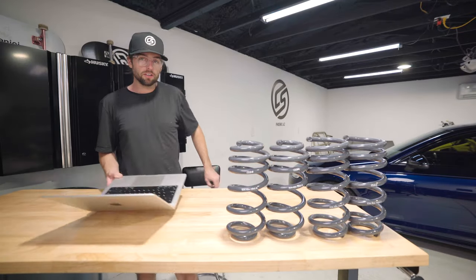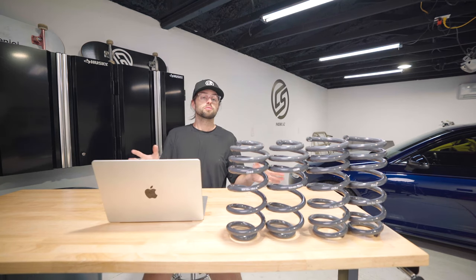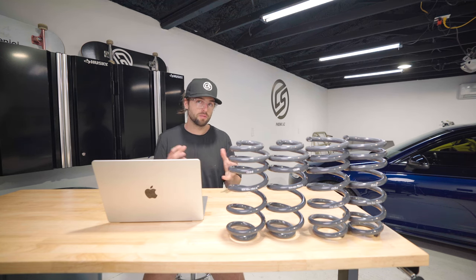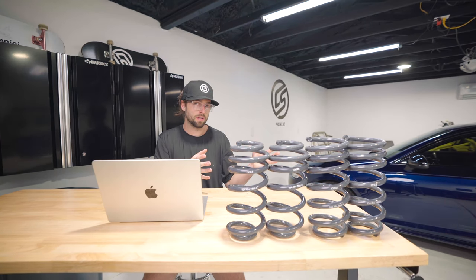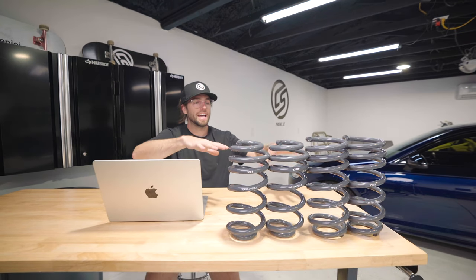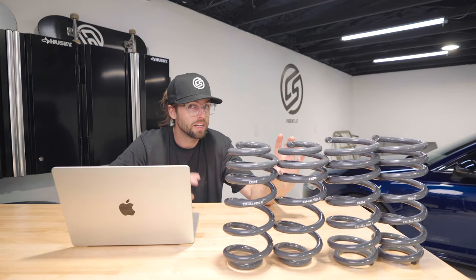Let's talk about the details on these springs. Who makes these? 034 is Audi enthusiasts, independent thinkers, independent doers that make awesome parts. And they took their car to the track, figured out what they liked and didn't like, made springs, did testing, figured out which is the best of both worlds, and this is it. The goal is to make a spring setup that works well with the stock dampers, that's smooth, and can take advantage of how the suspension can get stiffer or softer with the active damping, like a car like this that has technology. To do that, you would think that the spring would be just shorter, but actually, when it's sitting with weight on it, it compresses and stacks differently. So when you put it on, they're close to the same as factory springs, but they compress differently and stack.